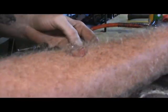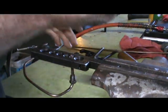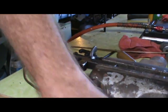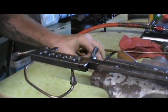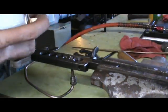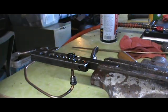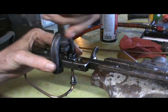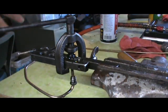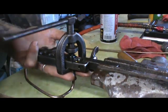I'm going to move this back so I don't knock it off on the floor. That's good and tight — let me tighten my vice a little bit. 3/16ths — you'll see on top of most of them your 3/16ths marked there. I'm going to shoot just a little bit of oil to overcome the friction. This stuff — I can't say enough about it. It is so much better than the old school brake line. A little more expensive, but it's worth it. We've got that part done.